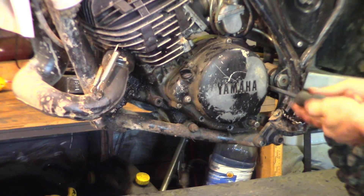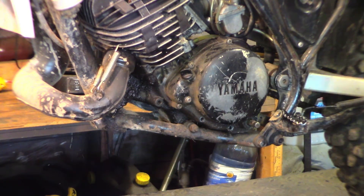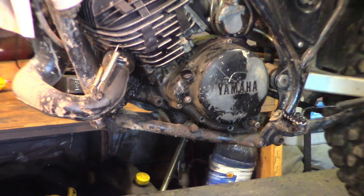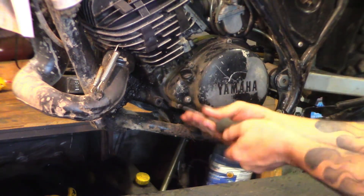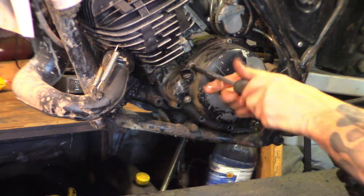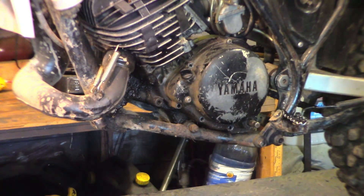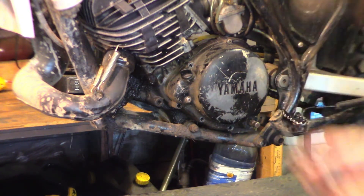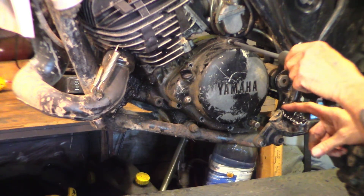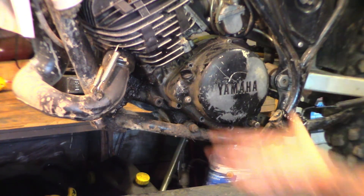I do not have a new gasket for it — I believe this is actually a new gasket. I think I put a new one on there when I had the cover off last, but we're still going to be extremely careful and try not to break it because I don't have another one. All the same length so far. When you're disassembling things, make sure the fasteners you're taking out are all the same length — it can break things severely if you don't put them back in the right spot. I've got to take the foot peg off because I won't be able to slide this out far enough.